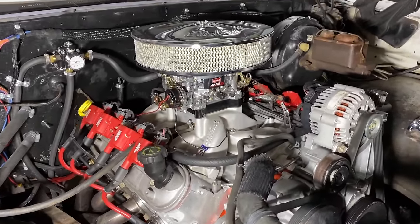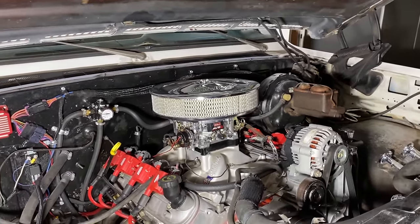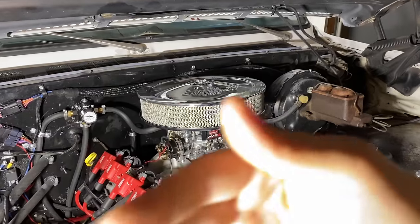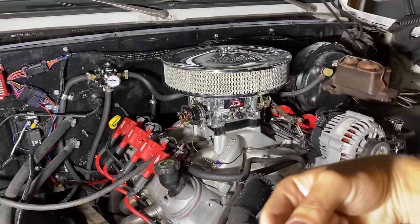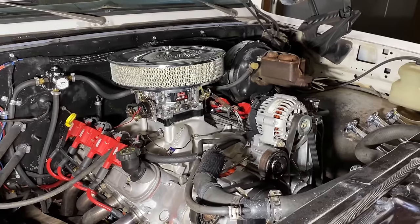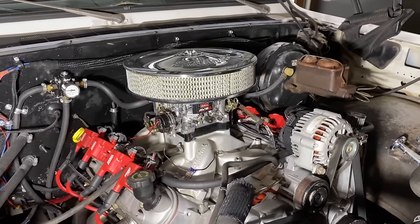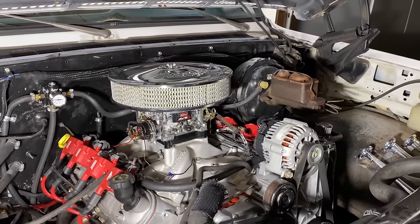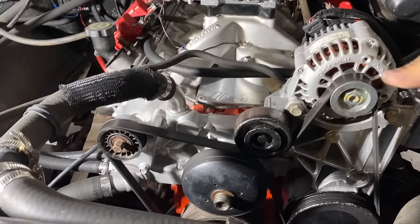As far as transmission, I ran a Turbo 350. The only thing you have to do is you don't use one bell housing bolt, and you have to either get a different flex plate or get the flat version flex plate with a spacer that has the correct torque converter snout size, then machine the holes toward the inside of the flex plate. The Turbo 350 is an inch smaller in bolt pattern diameter than a Turbo 400 or 4L80.